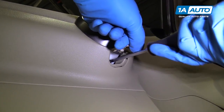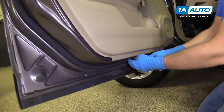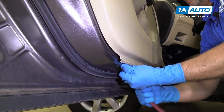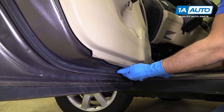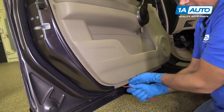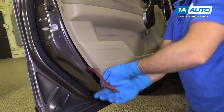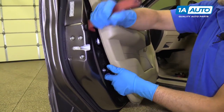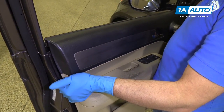There's a Phillips head screw right here. Take this one out. We're going to use a trim tool and go underneath here and just pop off the door panel. And go all the way around. Pop in the door pins. Just like that. Once this is all loose, you can lift up on the door panel,